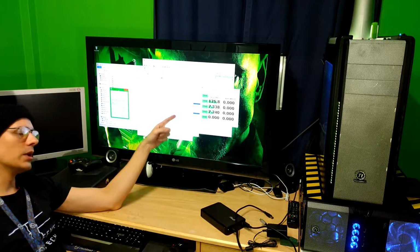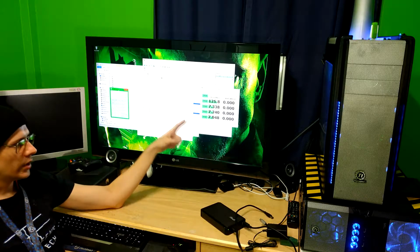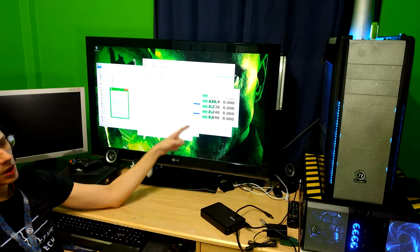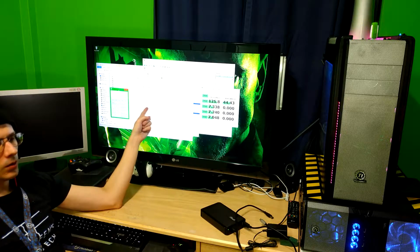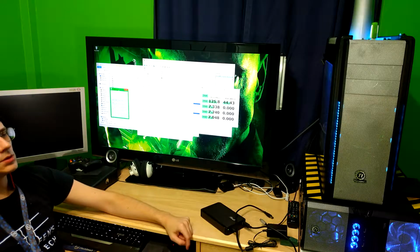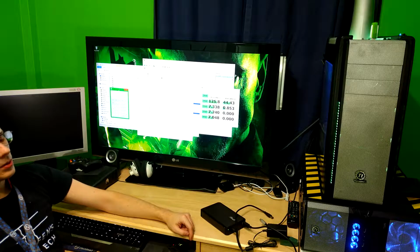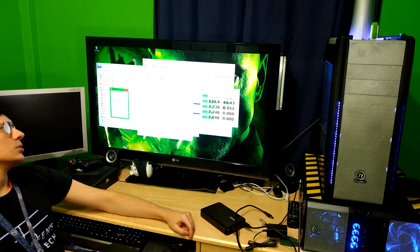So okay, now we can already see here from the USB that is taking the test, that is 125.8. So we can see that the hard drive through the USB 3.0 is faster than that, so that can't give us a bottleneck limit to see how high that number could be. I don't know what else to do from here besides say that the USB 3.0 is not going to be as fast as plugging it in through the SATA, even though they advertise that the speeds can handle up to that. So that is something good to know, eh?